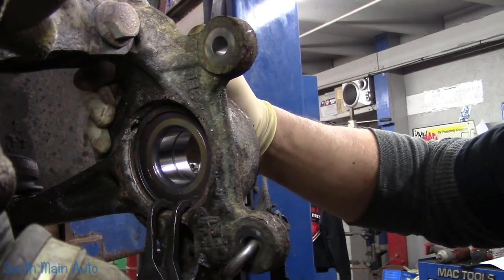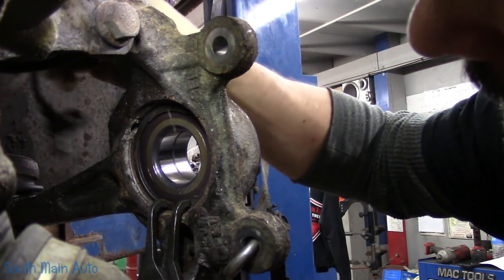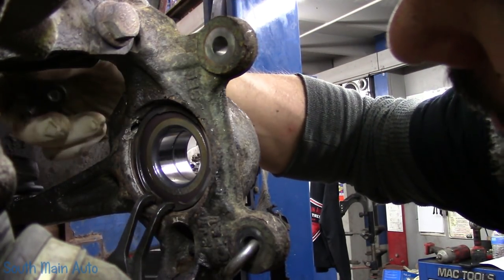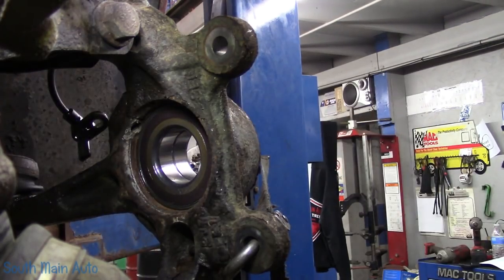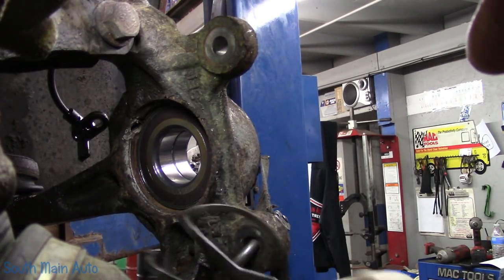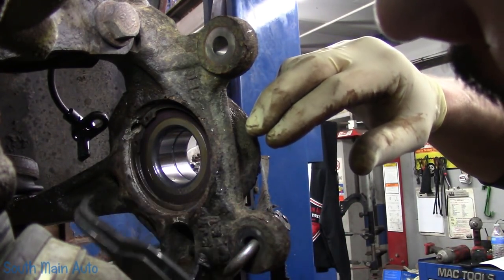Was that opening at the speed sensor? Well, the speed sensor will fit regardless of where the snap ring is, right? Ah, it will not. Oh, good to know, fella. Good to know. GTN for you texters. No, GTK. I don't even know how to spell the word no. So the slot in the snap ring has to go up here. Wow.